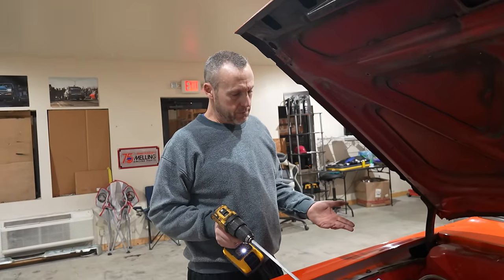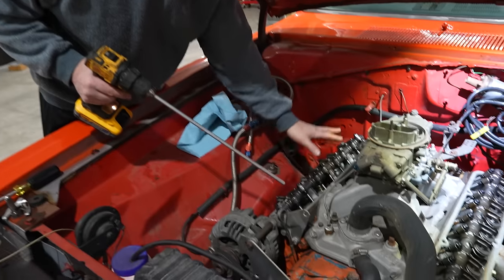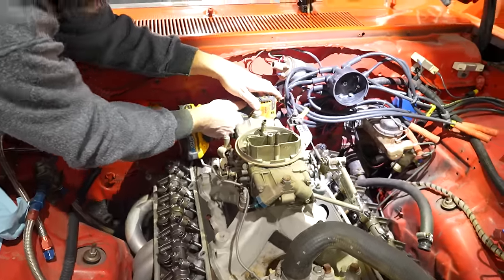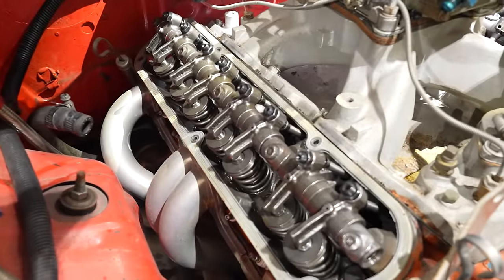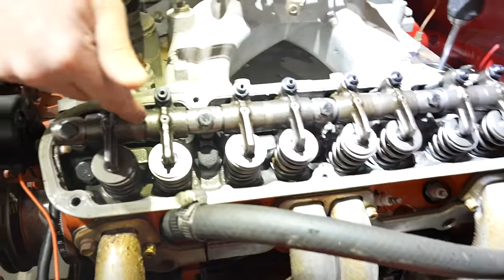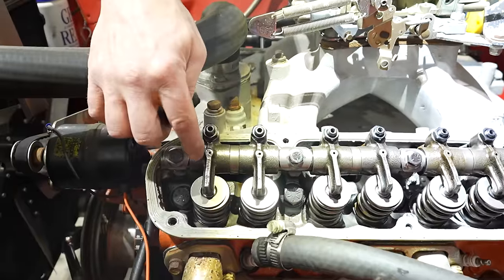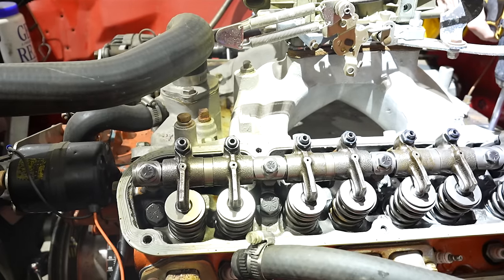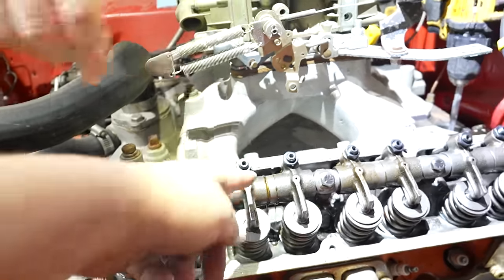We got it ready to prime. So we're going to give it oil pressure. This goes clear down into the oil pump, all the way down into the bottom of the pan. And it's already grabbing — so it should oil that side first. There it goes. So on a Mopar, the bottom of the rocker shaft underneath the rocker arm is where the oil comes out — that's what oils the rockers. You're going to start to see oil squirt out from everywhere once we get pressure, which we're getting now. 30... just under 40 psi.